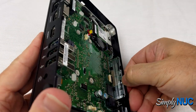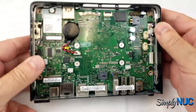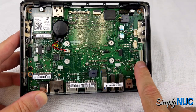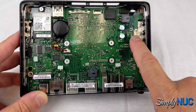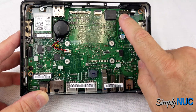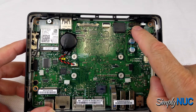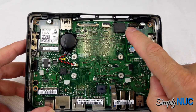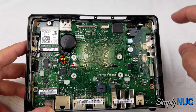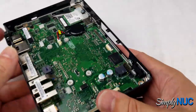First, I'm going to take out the I/O panel — there are a couple of plastic snaps and it comes right out. You can see the EMI shielding. Inside, starting from this side: we have the USB 3.0 port, two USB 2.0 ports, the front panel power switch, and next to it a front panel connector with power switch support, power LED, suspend/sleep LED, and drive activity LED. If you need remote power or remote LEDs, you can plug them in here.